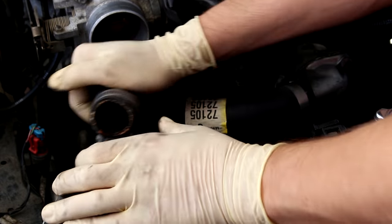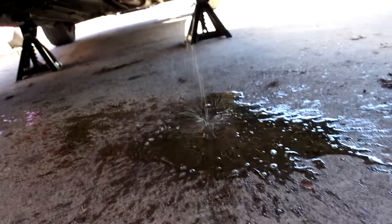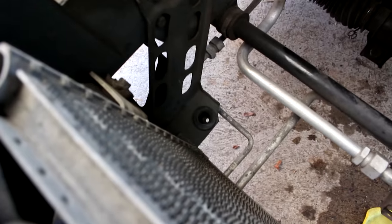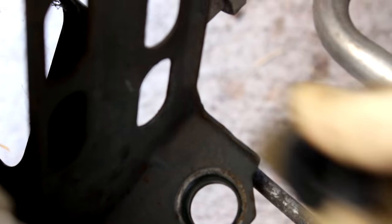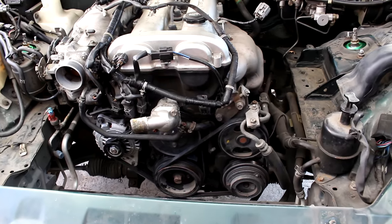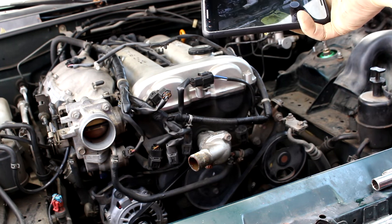Remove the upper radiator hose, disconnect your fans, remove the lower radiator hose — having your receptacle ready so you don't explode coolant everywhere like I just did. Remove the upper radiator brackets, and then this thing can just pull right out. Don't forget about the little rubber grommets that sit below the radiator — they will fall out at will and roll away. You're going to have to put those back in when you reinstall the radiator. Look at how much space we've already generated in just a few minutes. Now is also a good time to start taking some pictures with your phone.